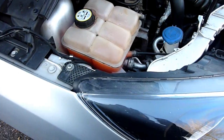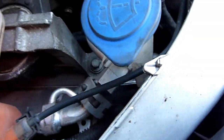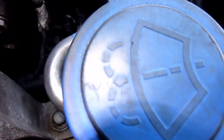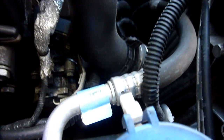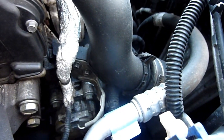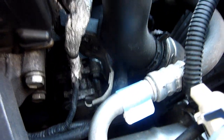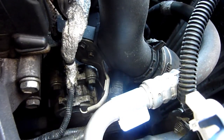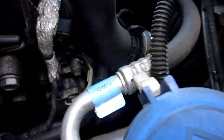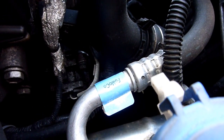Check the horn — that's one of the tests. Good, it's fine. Next, check the air conditioning system. I'm going to look down here — I think I've got a slight leak in the air conditioning pump. My air conditioning clutch is not coming on, which means the week before my inspection I'm going to be pumping some air conditioning fluid in. The air conditioning clutch is down there — check if it's spinning with the aircon on. Mine's not, so that needs to be fixed.